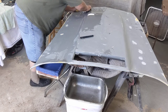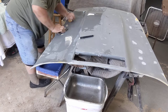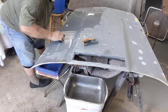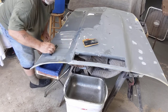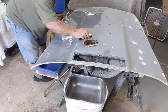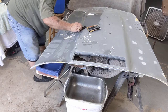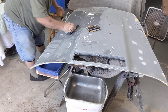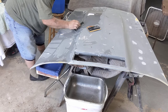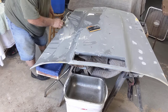Nice warm day in Texas — 98 degrees outside. I'd hate to be doing this without being in the garage with the fans running. You can see that once I squeegee this off — and there are plenty of videos on this — but if you have not done this and you want to learn how to wet sand back down and reshoot a blemish, I hope this helps. I usually let one or two drops of Dawn soap when I'm doing this — it helps the sandpaper from getting clogged up.